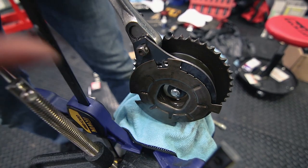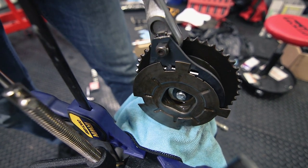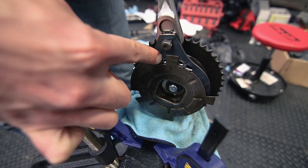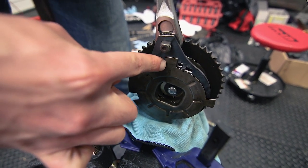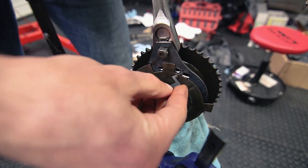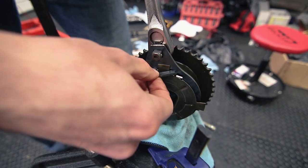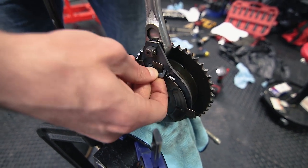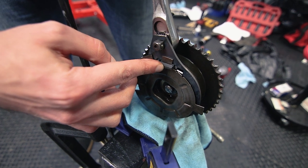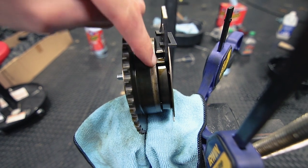Now come on the trigger wheel side and apply a clockwise force to the spring until the two circle holes are lined up around this trigger. Then take this lock and wiggle it in — it's a very tight fit. And slowly release the pressure on the spring until it's locked in place. As you can see, the cam gear pin no longer has the spring tension on it.